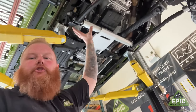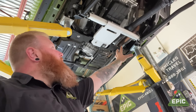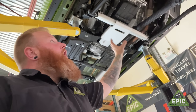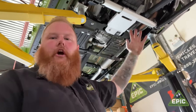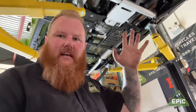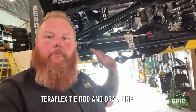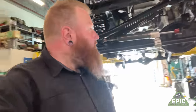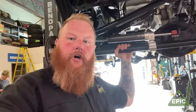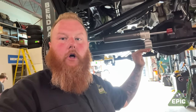As you can see, there's a whole new crossmember connecting the new brackets for strength side to side in aluminum. We've got the brackets moved back what looks like almost a foot, so these arms are significantly longer. Obviously all the arms come equipped with the Alpine IR bushings, and we also pressed out the bushings in the front diff and put in IR bushings as well, so it all has independent rotation. We also decided this time to do an upgraded drag link and tie rods, since it's getting really popular to upgrade your steering before anything actually happens to it.